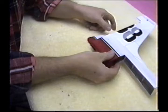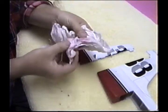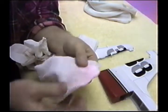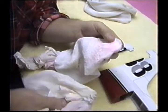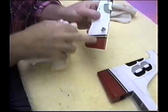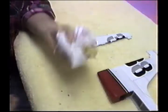Today I'm going to start on two of the smaller parts. When you let these things sit overnight — this is where I was done buffing yesterday — they get kind of gritty. Especially the socks. There was a time I thought I'd just wash the socks and use them over, but they lose their fuzziness. So when you start a new day, get rid of all the old stuff. Because if you put a scratch in now, by the time you get the scratch out, you might be down through the paint. It's the bottom of the ninth — you don't want to strike out. Deep-six the old materials and get all new stuff.